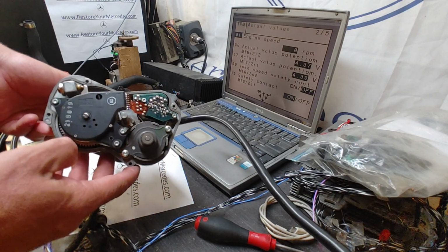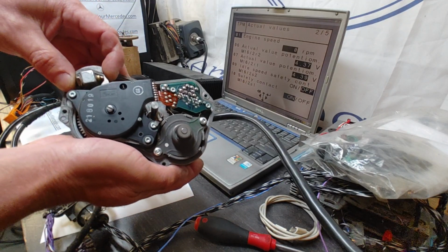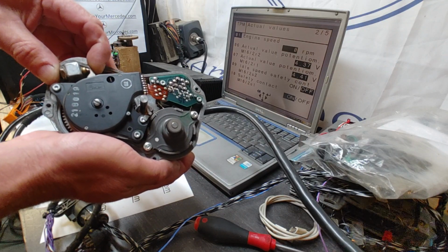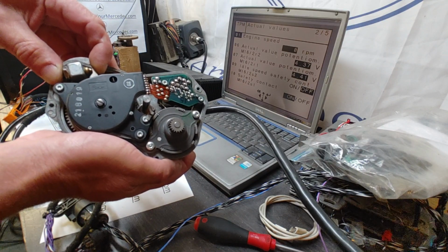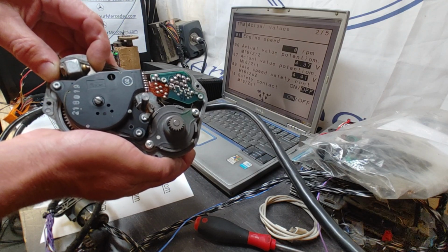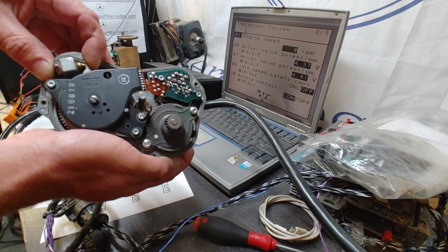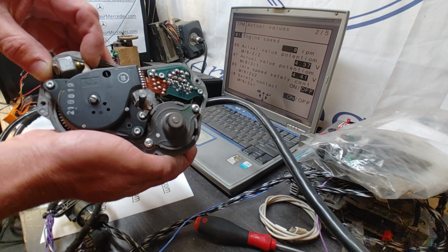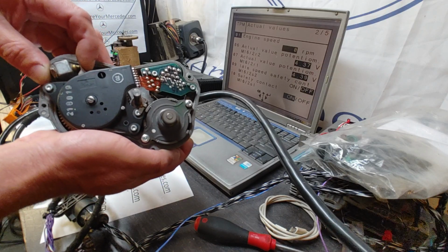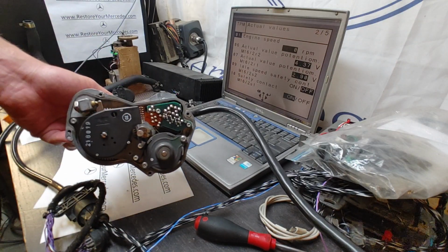Now the motor is trying to spin. It tries to bring the plate to the position where it needs to be. If I move the plate slightly, I can stop the motor, because the potentiometer reads. There, I have it stopped. It's a very delicate process to get this thing to be exactly where the controller wants the plate to be. As you can see, it's just moving like crazy now, because it senses the plate motion.